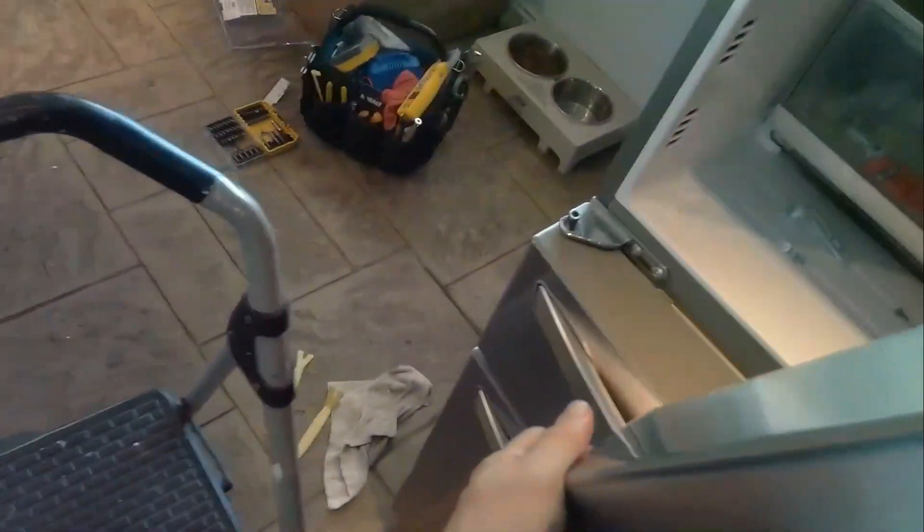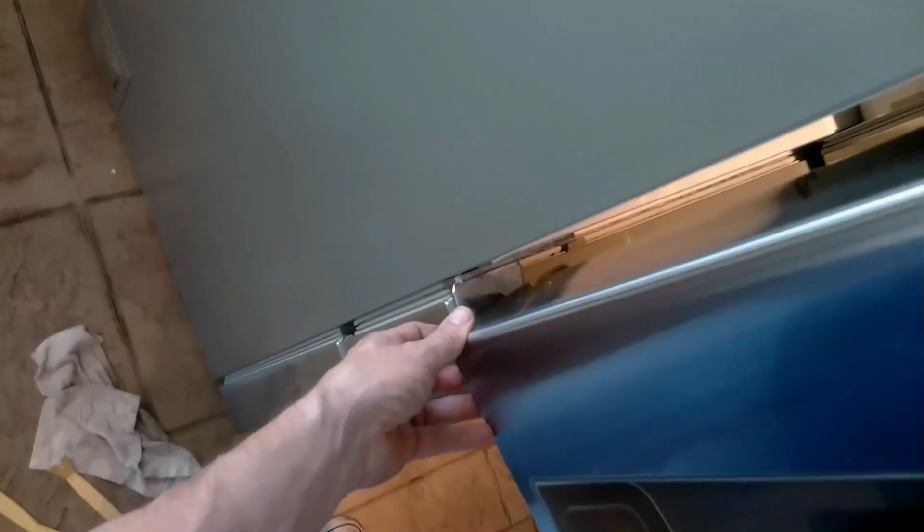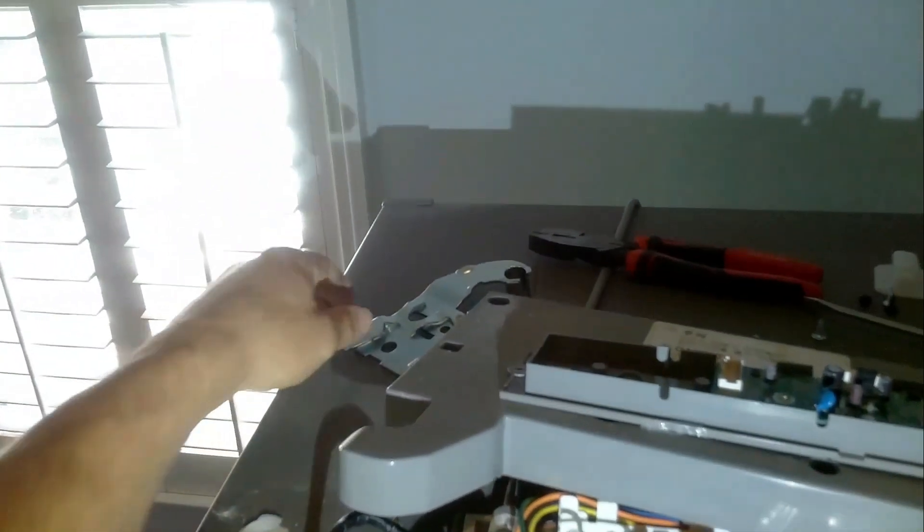So let's install the new door. This is one you definitely want to be careful with. Just lift it up, get some help if you need. You have a hole up under the door that'll click into this hinge here. Fill your finger where you know where to put it and then open the door until it clicks. The door is really not lined up like it's supposed to — it's kind of high, so that means it's not clicked in yet. Once it clicks down into place, shut the door. That's why we have to put the gasket on — take the gasket off the other one and put it on this one. At this point we just want to make sure the door is locked in so we can continue working.